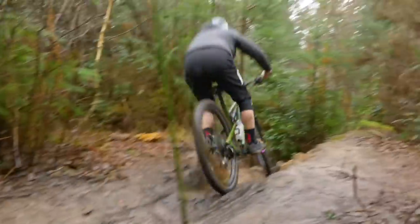The good news is that handlebar standards aren't that varied — everything goes off the same grip diameter, with 31.8mm and 35mm clamp diameters at the stem, and that's it. Finally, I want everyone to go out and experiment. You'll find things that are undoubtedly worse, but at least you'll quantify what that feels like. You might also find something that works better. There's such a complicated relationship between all parts of our cockpit and contact points that experimenting is absolutely invaluable and will help you problem-solve in the future. Thanks for watching and we'll see you next time.